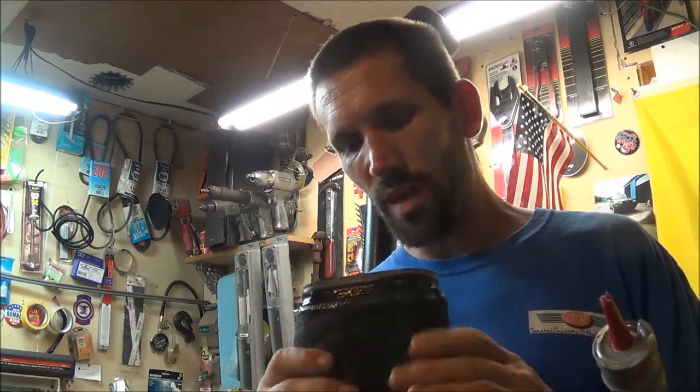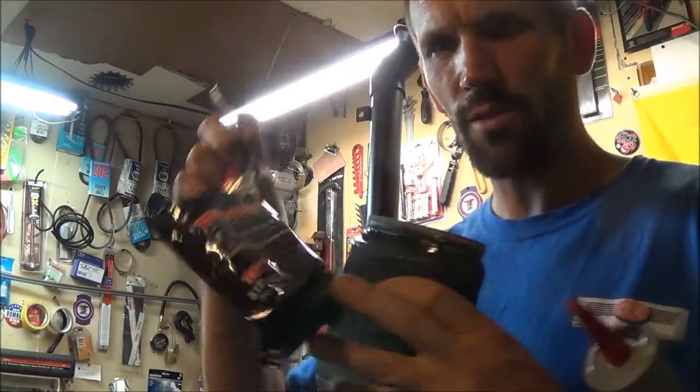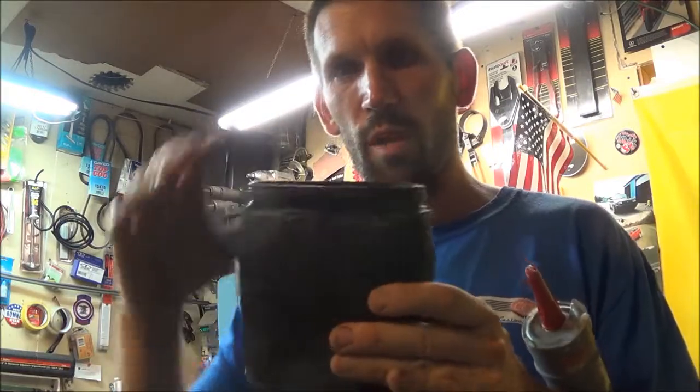All right. So the next thing I had to address was the boot that goes from the airbox to the fender. They're made out of a fiber with a steel cord that runs through it, and they're notorious for deteriorating. The only one I've ever seen that wasn't was Justin's on his 04 D2. So basically what I did is I peeled the crap off the rubber boots, and I took a piece of Kydex, heated it and shaped it to those rubber boots, and then I took this fiberglass wrap that you soak in water and wrapped it and made it a rigid boot with the rubber ends on each end.